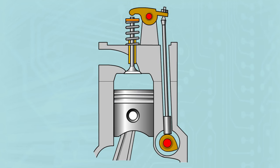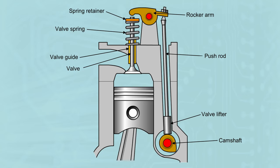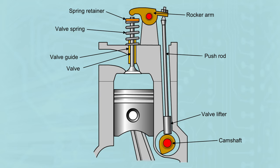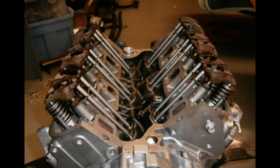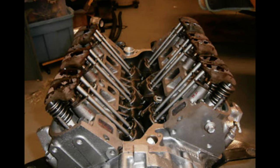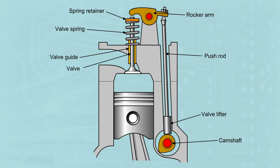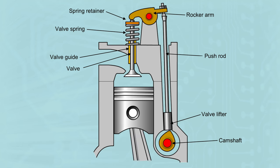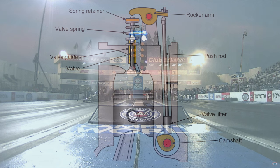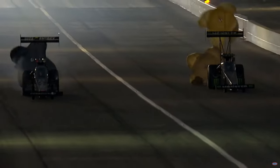This design here is an overhead valve engine. As you can see, the valve is situated at the top of the cylinder. The camshaft is situated through the cylinder block and indirectly operates the valve via a valve lifter, a push rod, and a rocker arm. There are lots of moving parts in this design and lots of opportunity for mechanical loss and failure. However, it is also very easily adjustable. The push rod can also be utilised as a sacrificial item in case of engine timing failure, and the ratio of the rocker arm can change to increase valve lift without having to replace the camshaft. A top fuel dragster still uses this engine configuration and can make up to 10,000 horsepower.